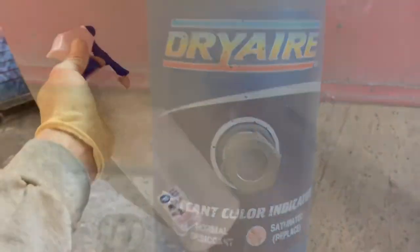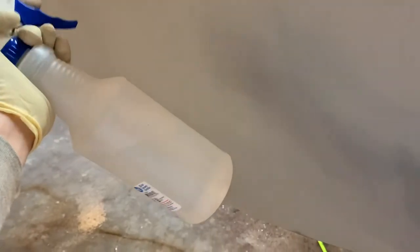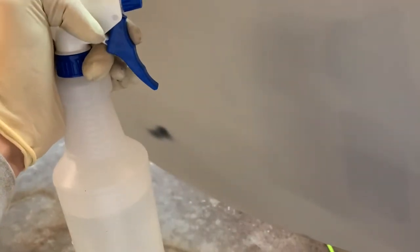What I've got here is a pre-wipe homemade cleaner — all it is is distilled water and isopropyl alcohol mixed about 75/25. This is going to get the dust out of all the small scratches in your panel. The wax and grease remover will get dust out, but not as well as a water-based solution.